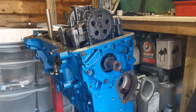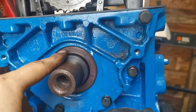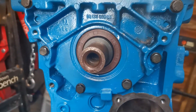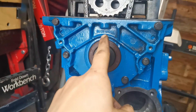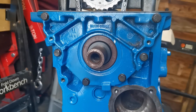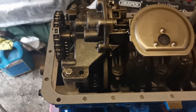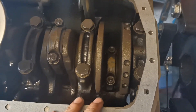That's done. Now we need to put an oil seal in there — I just used a rubber mallet and tapped it in evenly around the edges. I've chipped my very poor quality paint job, but that's because I used most of the paint on the actual engine and forgot about this piece, so I just used whatever was left. Moving on, we've got the oil pan sump to put on now, and I've got a proper sump gasket in the kit.